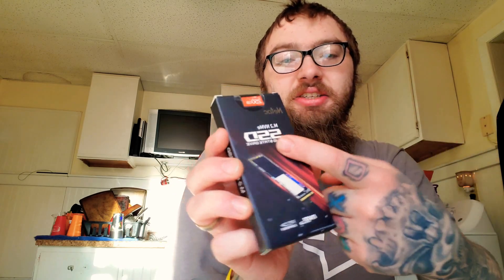Today, I have a new SSD — as you can see, it's very shiny. This one cost me about $34, and I'm selling it to someone on eBay for $26, so I only lost about $10. I went and got this guy for $70, which is a 512GB XPG Gamix S50 Lite. Now this is a PCIe 4.0, which is what is required to install in the PS5. The previous one was a Gen 3, and this one is a Gen 4 — that's why the other one didn't work in the PS5.